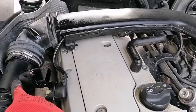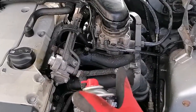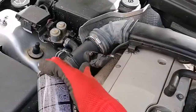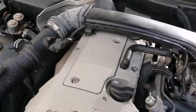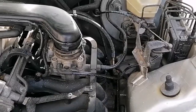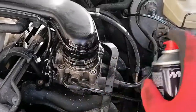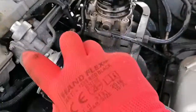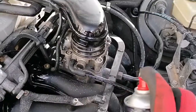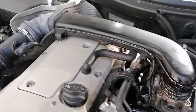I think the smoke test is really the way to go here. I've been spraying all around the intake manifold, the throttle body, the air connection going to the mass airflow sensor, and even some pipes coming out of the throttle body assembly. I couldn't really hear any change at all, and the engine just idled exactly the same.